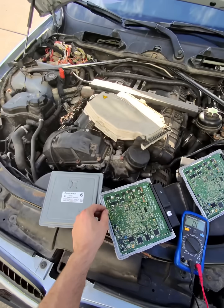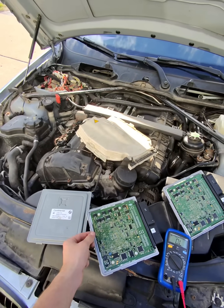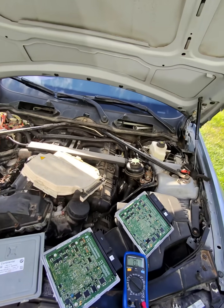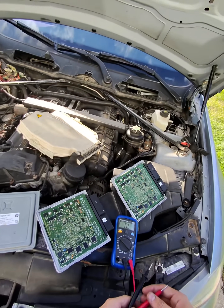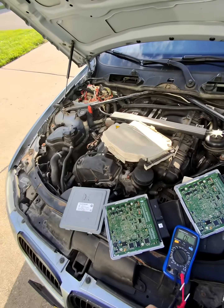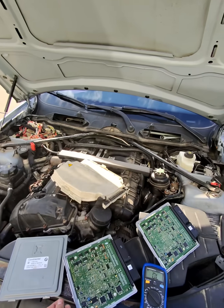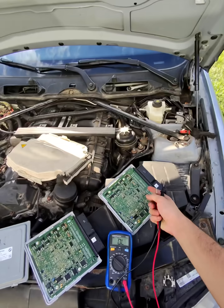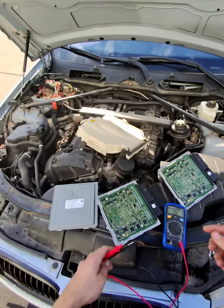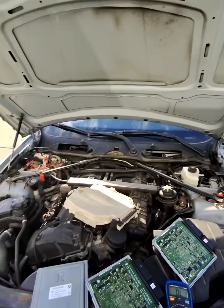You're going to have to get the transistor replaced — you can solder it off and put a new one on to see if that changes anything. Or you can get the same part number ECU. You'll need to take your original DME out, get the replacement DME, and send it to someone who can clone the DMEs. Hopefully that gets it fixed.